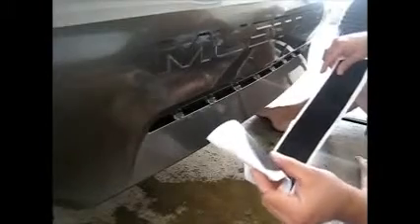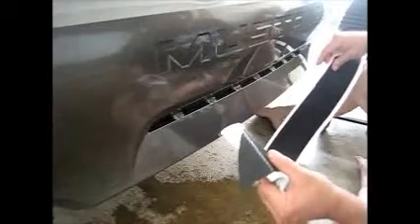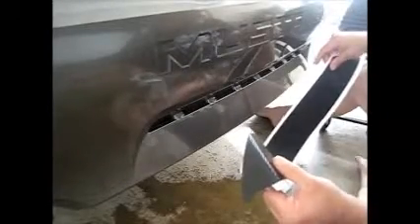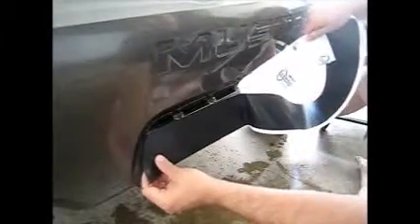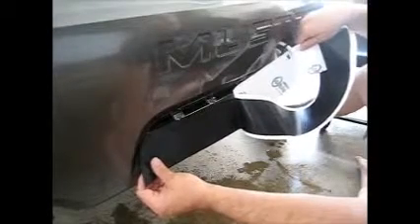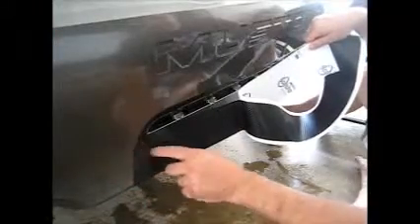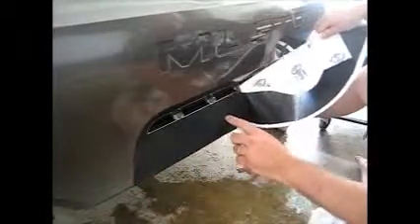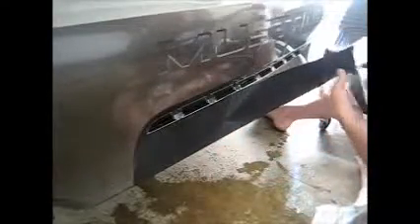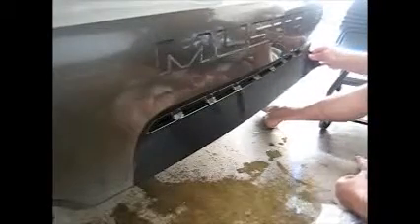This has the air release technology. The best thing I can tell people with this stuff is, like any other vinyl, take your time, be patient. It's not a permanent piece until you apply pressure. So I'm going to take the decal and pop it in place. I'm not trying to put it in the final resting position, even though close to it would be great. I'm pretty much doing this to keep it in place, and I want to show you what I mean by the fact that it's not permanent until you apply pressure.